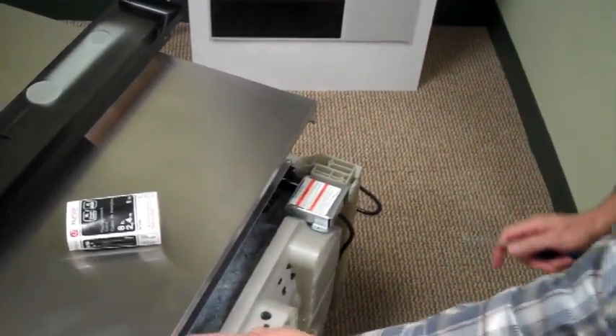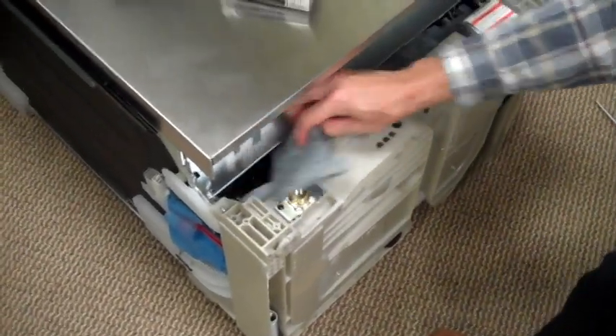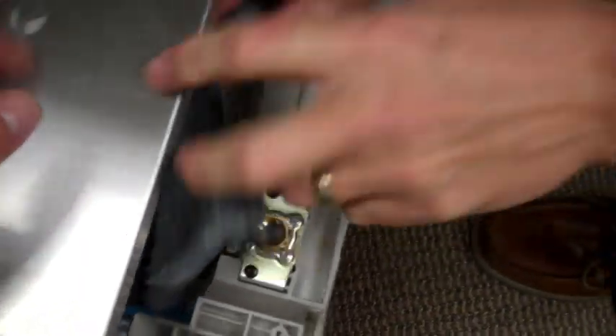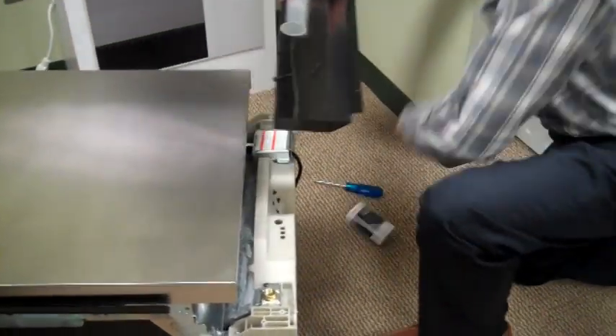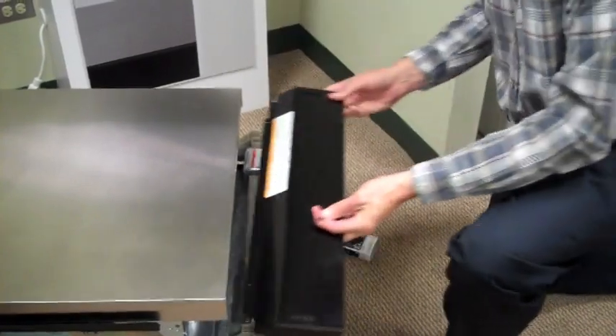While it's on its back, you'll need to dig out the drain pump connection, which is right here. Notice the wires going to it where my finger is. Lift the little cover up, grab the connector, and pull it out just like so. At this point you can put the cover back and the kick plate back on.